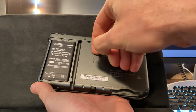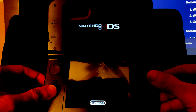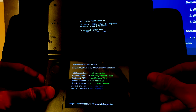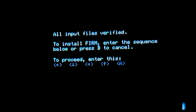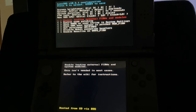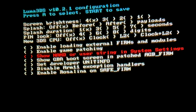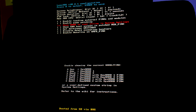Close out any File Explorer windows, remove your SD or micro SD card from your computer, put it back into your 2DS or 3DS system, and then power it on. From the main menu, navigate to Pokemon Picross and launch the game for the first time. It's actually going to bypass the game launch itself and go into what's called the Safe B9S menu system. In the bottom touch display, you should see a message that says 'All checks passed' — if you don't see this, don't proceed. When you scroll up to the top menu, you'll see a series of directional D-pad presses and a letter to press in order to activate the next step. Follow those key combinations exactly as shown on your device. If you've done everything correctly, you'll boot into the Luma 3DS setup menu. Use the D-pad to move the red highlight down to 'Show NAND or User String in System Settings' and select it with the A button. Once you have this selected, press the Start button on your device to reboot.